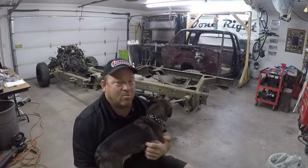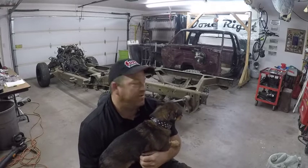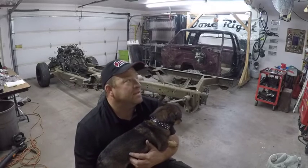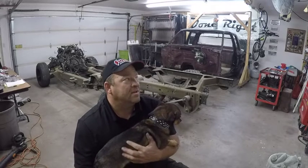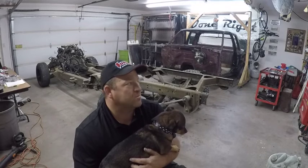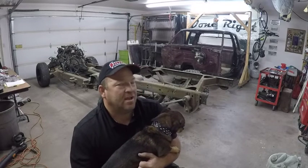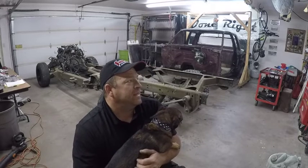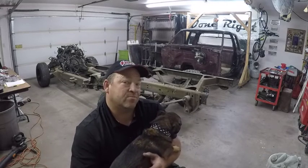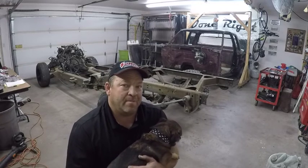We got it all done — cab is pulled with the bed off. It took about six days with a little bit of help. Our goal was April 15th and we hit that, with 14 days left. Now I need to gather everything up and send it off to the sandblaster. I'm going to do another video on disassembly of the door panels and removing the windows. We also need to pull the blower box, take out the condenser and heater core, and remove the door handle and latches on the tailgate. A couple more videos left, but mission accomplished. Please rate, subscribe, comment, and we'll see you guys next week.